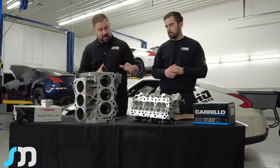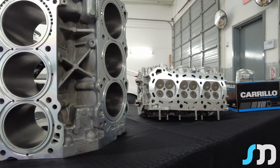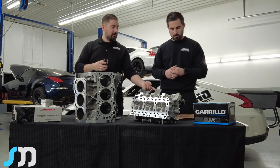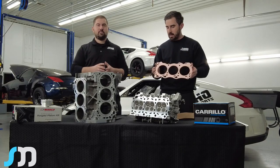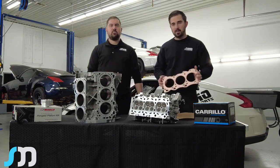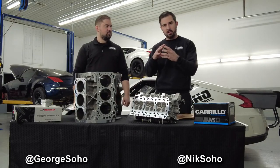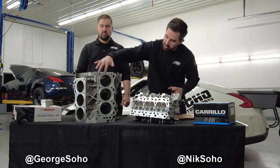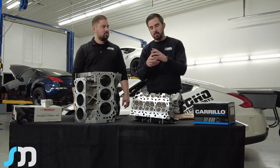This is a one-piece stainless steel o-ring that we press into the head — you can see it pressed in right here. There is a receiver groove in the block which accepts it to mate. We also pair that with a proprietary copper gasket that we developed, which we had Clark manufacture specifically to work with the top fuel hoop o-ring. The copper head gasket lays onto the block, and the receiver groove in the block is where everything comes together.